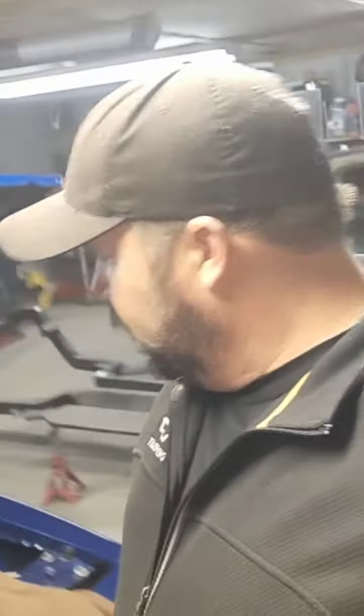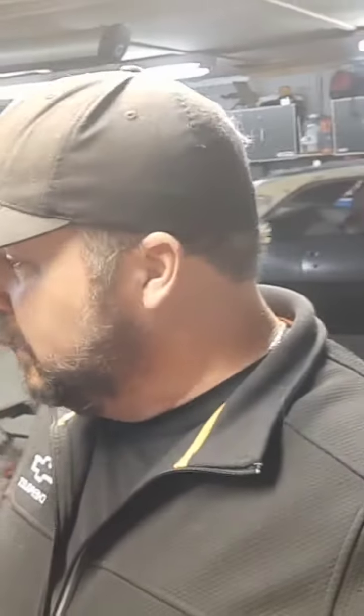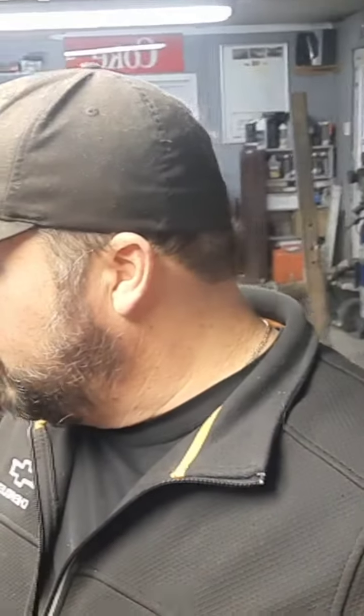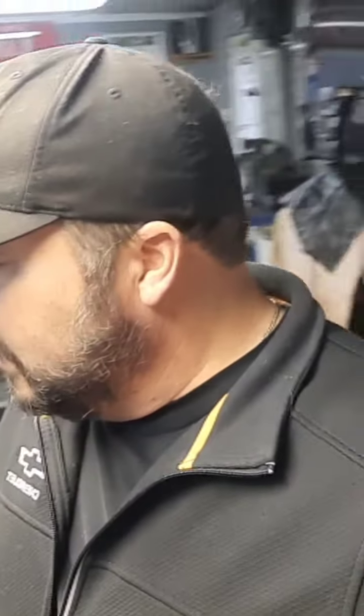Welcome back. I wanted to show you what I've been up to today at the Trans Am. We took the Trans Am apart and pulled the injectors out — it's developed a little misfire. We did compression tests and compression is good on all cylinders, so I'm not worried about that. I think there's a little dirt from up in the tank, so we hauled the injectors out and are going to send them to a fella to get flushed, cleaned, and flow tested to make sure everything's working good.